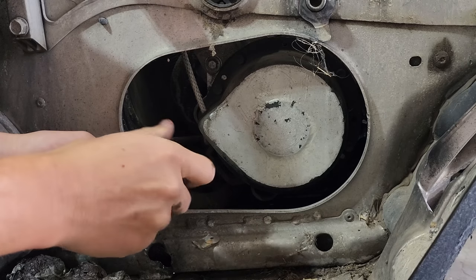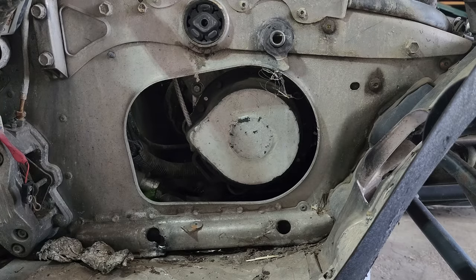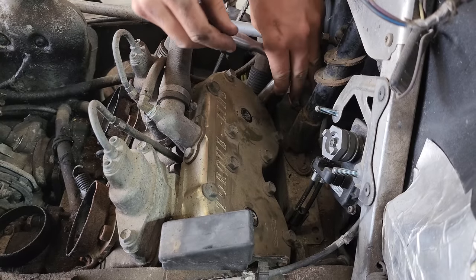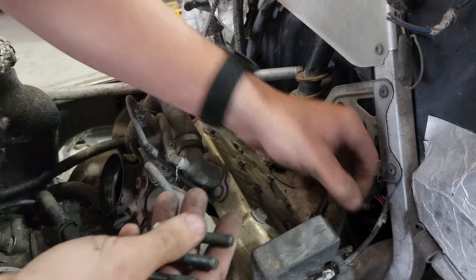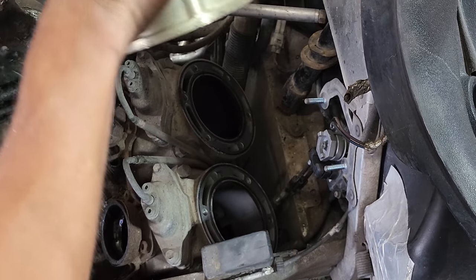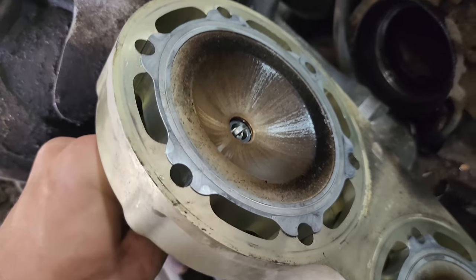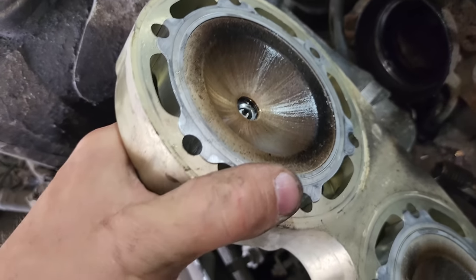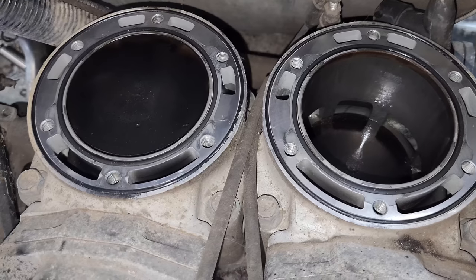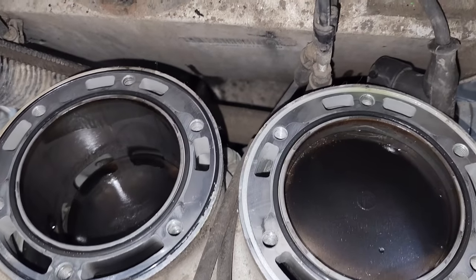Big heat exchanger means big mess. The head came off nicely. I screwed in the spark plugs because this whole dome is actually an insert — if I start unthreading that, it actually loosens it up. This whole thing wobbles around because these are actually interchangeable since the cylinder head fits a couple of different things. We're into our motor. We could reuse the gaskets if we had to, but I'll probably just order a new kit. This piston's at the top of its stroke — I can give the clutch a turn there.